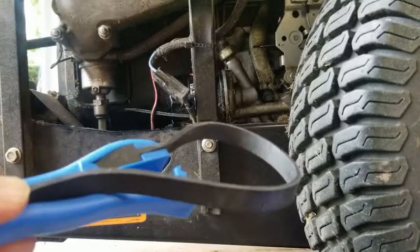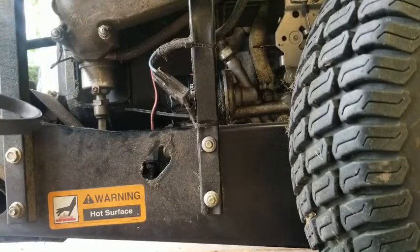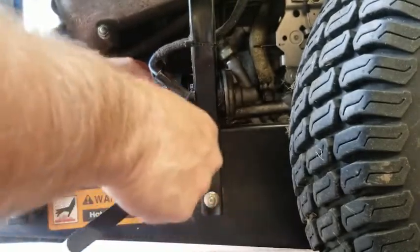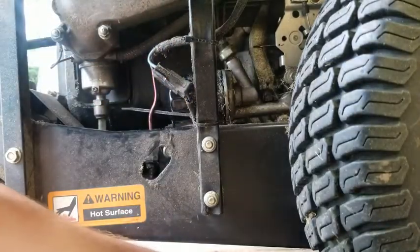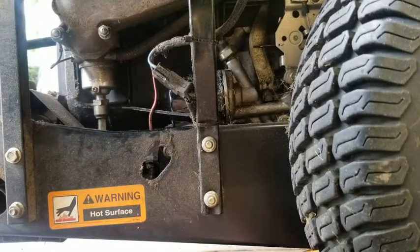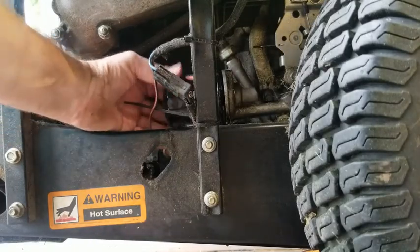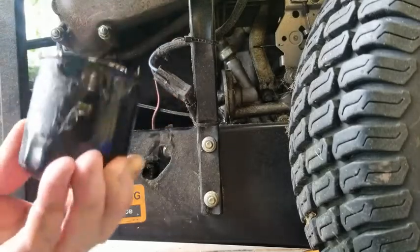We have this little baby oil filter wrench — you could use a bigger one. We're going to break this thing loose: put it on and turn it counterclockwise. Put this over here, push this down, and it should come off pretty easy — and it does. Back the pan up a little so we don't get oil on the floor. There we go, draining the oil. Let that little bit drain, then bring it out — there's the old oil filter.